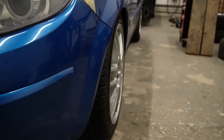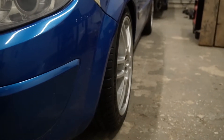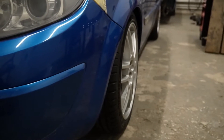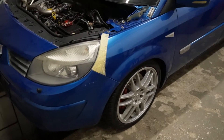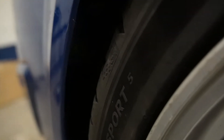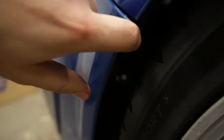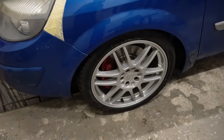You probably have like 2.5 degrees of camber up front with this. I would need, I guess, 10-16mm spacers, but I have my concerns. There's this tab right here that's holding the bumper, and I don't know if we will be able to clear that with spacers. We'll see.